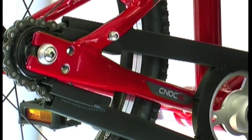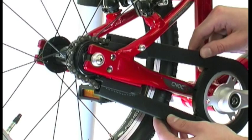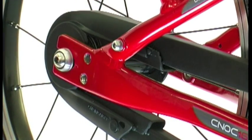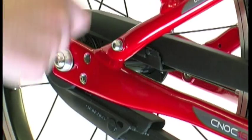Do not push this up tight — you should have 2-3mm of play to allow free movement of the chain guard. The second part slides over the rear sprocket. Once in place, connect the four pins: two at the bottom and two at the top.